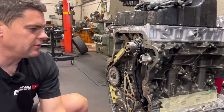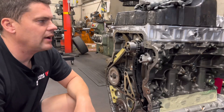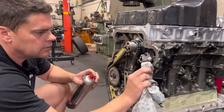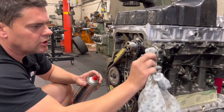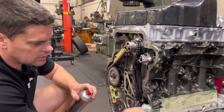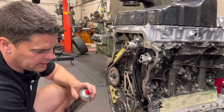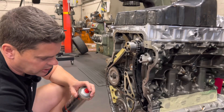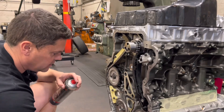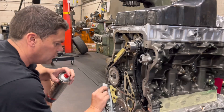Although it hasn't got it all off, it's softened it right up. What I'll do now is just go around there with a rag and some brake cleaner — that should wipe right off. Just a bit of brake cleaner on the cloth and you can see that's wiping straight off. That's a soft wire brush in the whizzy wheel there. You don't want to go too heavy, especially on the aluminium, because it just starts tearing the alloy up. All we're doing is just loosening it up, just enough to wipe off.